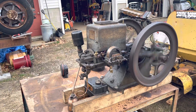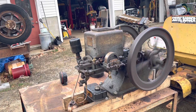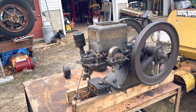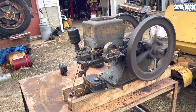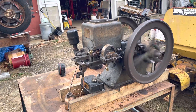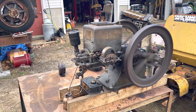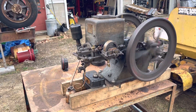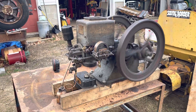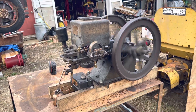I built it up with silicon bronze. I'm not quite sure how silicon bronze will wear on cast iron, but I was afraid if I used steel I would put way too much heat into it. So he's running. I'm not sure if you can get it started by spinning the flywheel, but we've got to address that fuel system so we'll be able to start it on the flywheel.